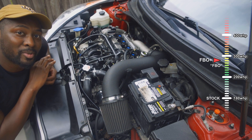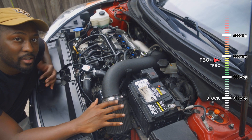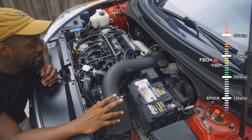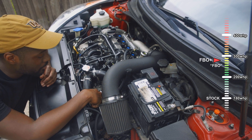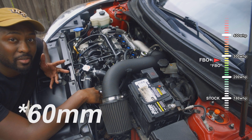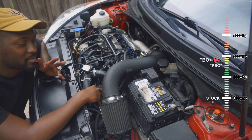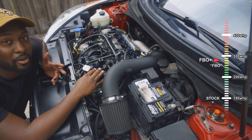You'll have a closed box design — it just depends on whether you want those turbo noises or not. You're also definitely talking about getting a bigger throttle body. The Elantra throttle body is around 57 or 60 millimeters, so it's bigger than the stock throttle body at least on the Veloster, but it depends on what car you're running and the small differences between them.